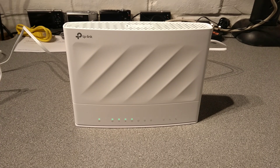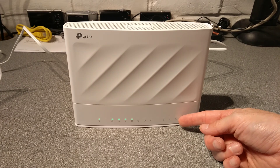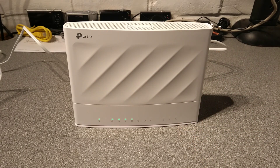And there we go. The router is back to factory settings. I can tell this because I had previously a telephone account configured, so the telephone light was on. Now the router has rebooted, the telephone light isn't on because it's lost those account settings.